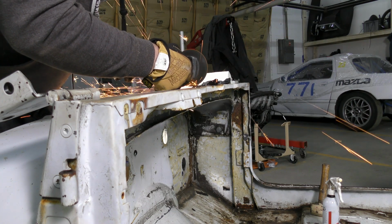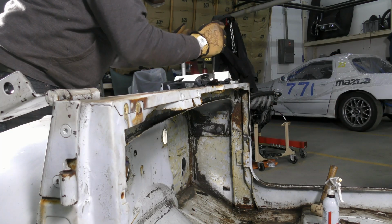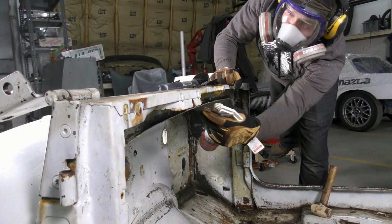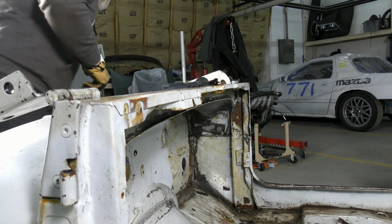There were a bunch of stuck bolts on this, and my traditional way of dealing with that is to just cut a slot in the head of the nut, go at it with a flathead screwdriver, and if that doesn't work, apply heat and penetrating lubricant. That combination has generally worked out really well for me, except for the most stubborn exceptions.